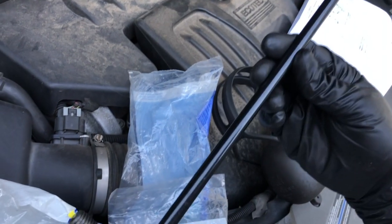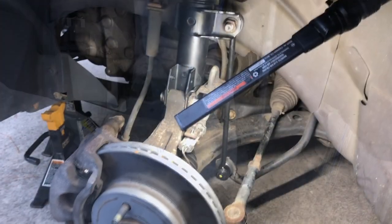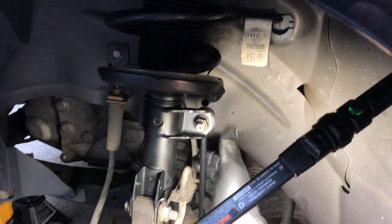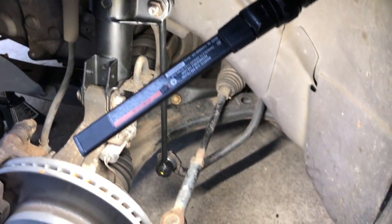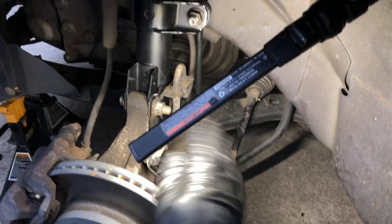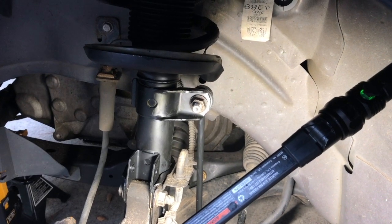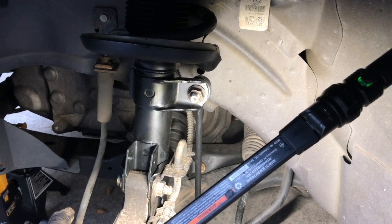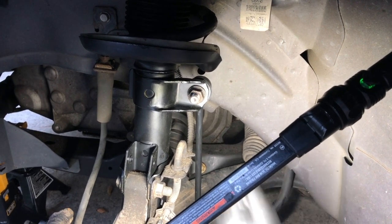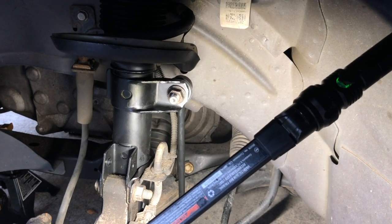This is our part, and now we're simply going to put it back on and torque it down. We've got this back in — 48 foot-pounds, top and bottom — and we're all set to go. I also recommend: if you end up having the removal problems I showed, always replace it with a new one. And if you replace one on one side, always replace it on the other side too so they're matching.